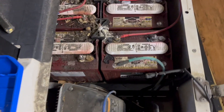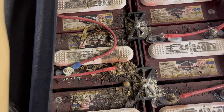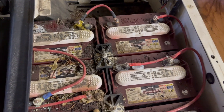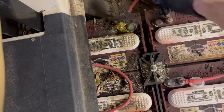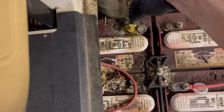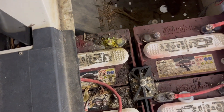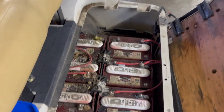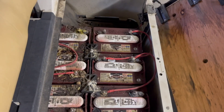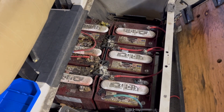Now all the cables are disconnected and the nuts are gone, but the cables are still on there. I tried to disturb the cables as little as I could so they'd stay connected. Take each cable one at a time and remove each end individually. Be careful about touching the ends, and also be careful whenever you put a tool down, because batteries are live all the time — even a dead battery might still have enough power to wake you up or hurt you, so watch what you're doing with both hands.